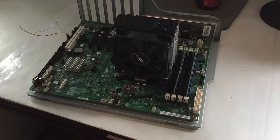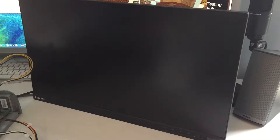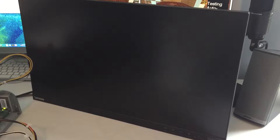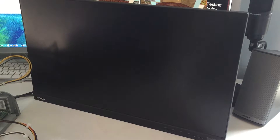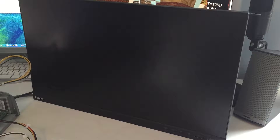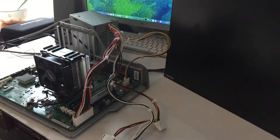As for plugging into a monitor, I do have a VGA cable down there - that is a first, having a cable that I actually need. I need some IECs for this. So I have everything plugged in now and we're almost ready to turn it on, just have to plug in the power supply. The standby lights come on on the board - that's good. So this board has those two wires sticking out of it. If I jump those together it simulates the power button being pressed. So let's go ahead and do that.